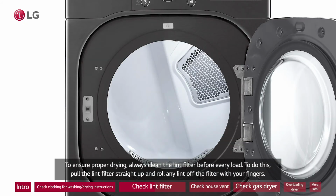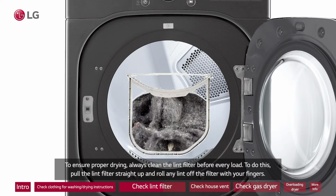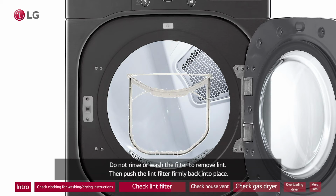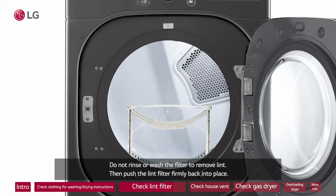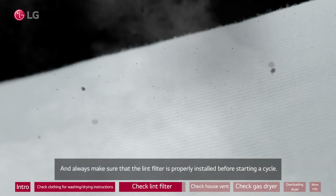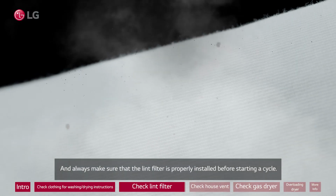To ensure proper drying, always clean the lint filter before every load. To do this, pull the lint filter straight up and roll any lint off the filter with your fingers. Do not rinse or wash the filter to remove lint. Then push the lint filter firmly back into place. And always make sure that the lint filter is properly installed before starting a cycle.